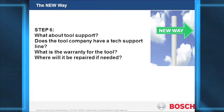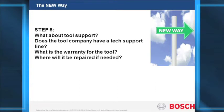One of the last things that we talked about was reprogramming. We didn't go into a lot of detail on reprogramming, but you and I both know the information today tells us that from 2005 and newer, 60% of cars are repaired by reprogramming with no parts involved. Agreed. I was over at a Chrysler Training Center and we were doing something on one of the cars. Every 15 to 20 minutes, we have a reflash for that. We have a reinitialization for that. And if I didn't know that, I would not be able to fix that car. Again, there are some cars where I'm going to put a new component on it, and I'm going to have to reflash that computer just to allow it to recognize the new component as different in coding and be able to access the information it needs to work on the network on the car.